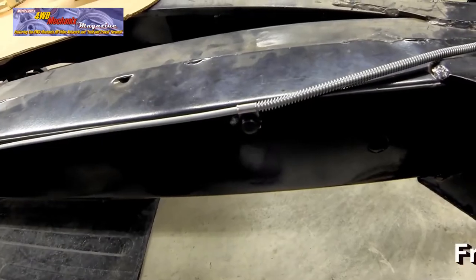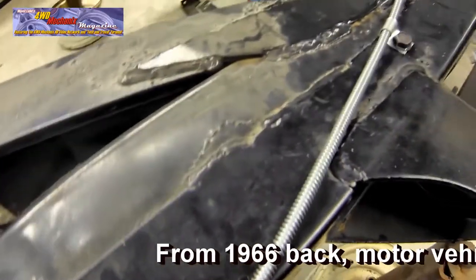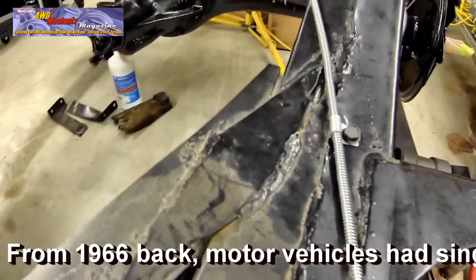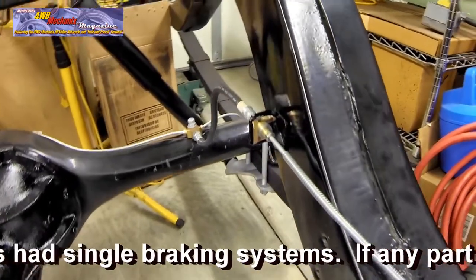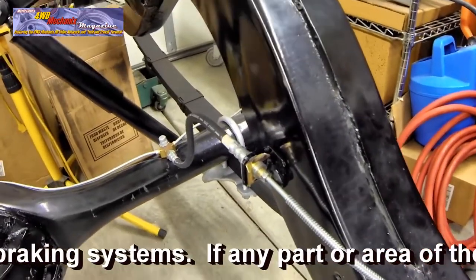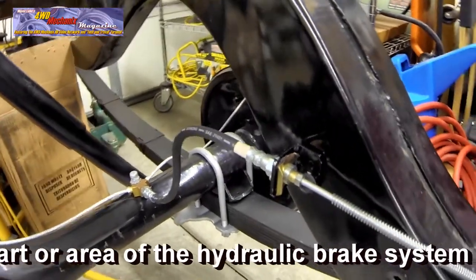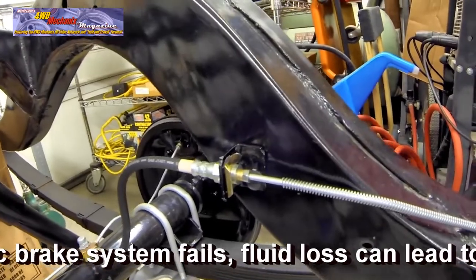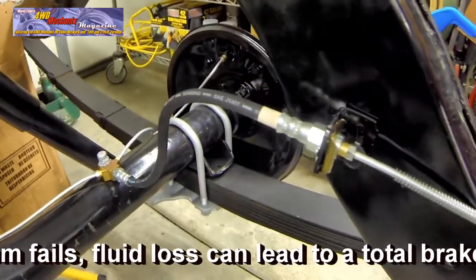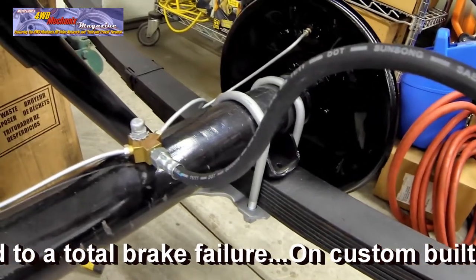This armor guard is shown in the factory parts illustrations. If careful attention is paid to the assembly of the car and the design of the frame and body, it's obvious that the body could chafe on the brake tube. Being a single braking system, that could be catastrophic. The body rubbing on the tube could wear a hole in the tube, and if that were to happen, there is no backup to the braking system.